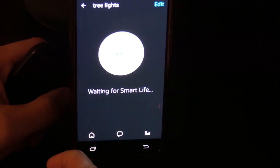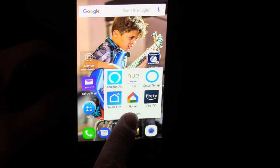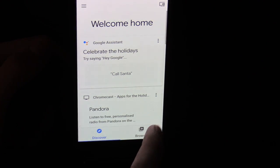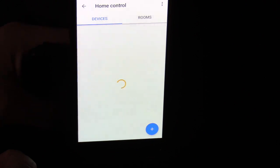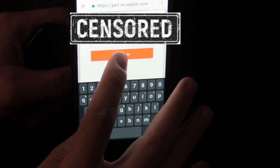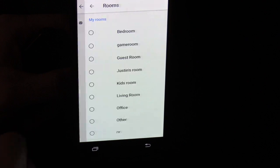You can turn it on and off using the Echo app or using your voice commands. Now to connect it to the Google Home, you want to make sure you download Google Home, and if you have it downloaded, make sure the app is updated. Click on the upper left-hand corner — that is the menu button — and click on Home Control. Click the plus on the bottom right and you want to search for Smart Life and select that. From this point, you want to put in your username and password and link. Then you want to assign it to a room.